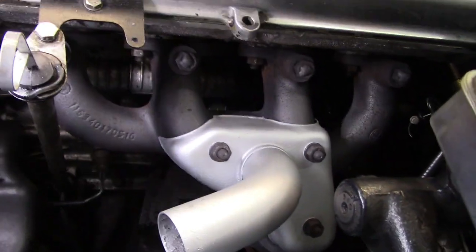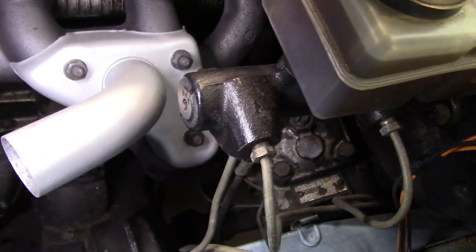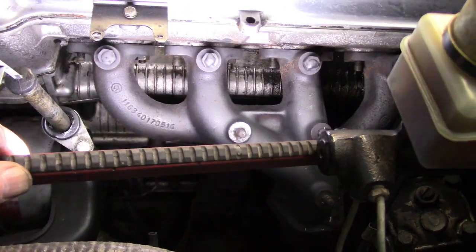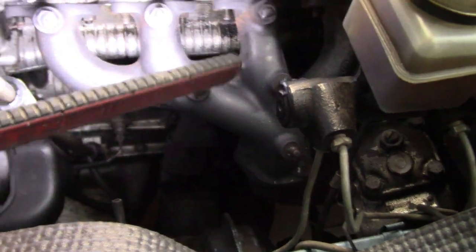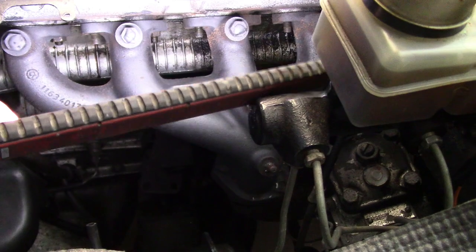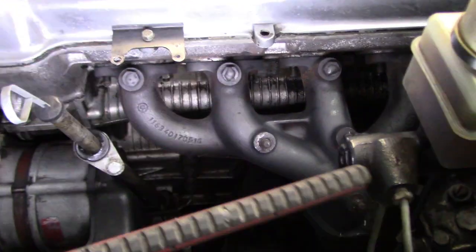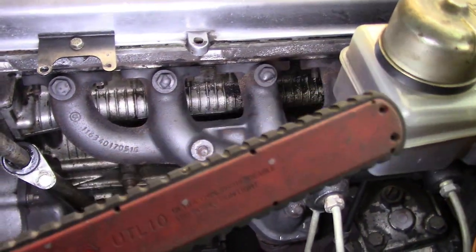We'll move this dipstick over, get that out of the way, and see if we can get some more room somehow. So there are 8 brass nuts total, 2 per branch of the manifold. We've got 4 of them off already, one's on the ground underneath the car. The more difficult ones are the ones below. Like I said, the top ones are easy. Let's go for the ones below and see how we do. Maybe a long extension somehow up underneath there. Anyway, go go gadget small hands.